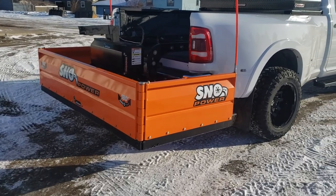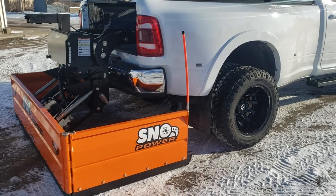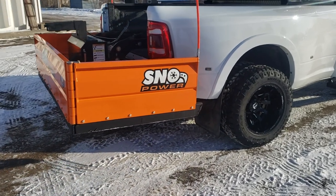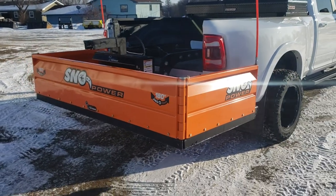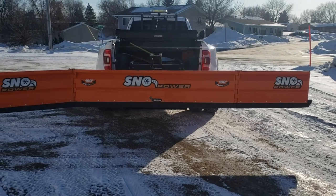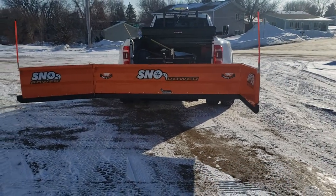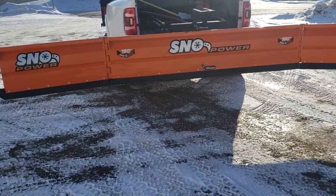Let me give you a quick demo of this pull plow. This plow has down pressure — it's got to be putting at least twenty-five hundred pounds of down pressure. It's a little bit taller than on other trucks; you'll see it lift the tires off the ground, but this truck is a little higher because of the 34.1-inch tall Duratracs. Here are the wings all the way out — it's got an eight-foot moldboard and four-foot wings, which gives us a total of sixteen feet straight out. They go in all different configurations, all the way back, so you can push in reverse or pull it forward.